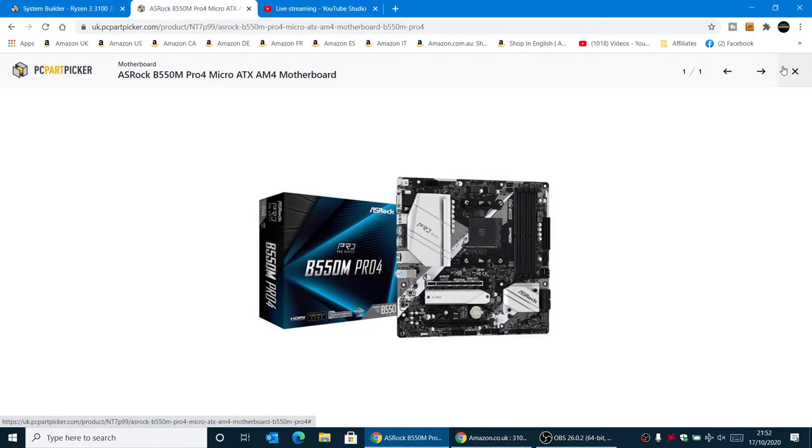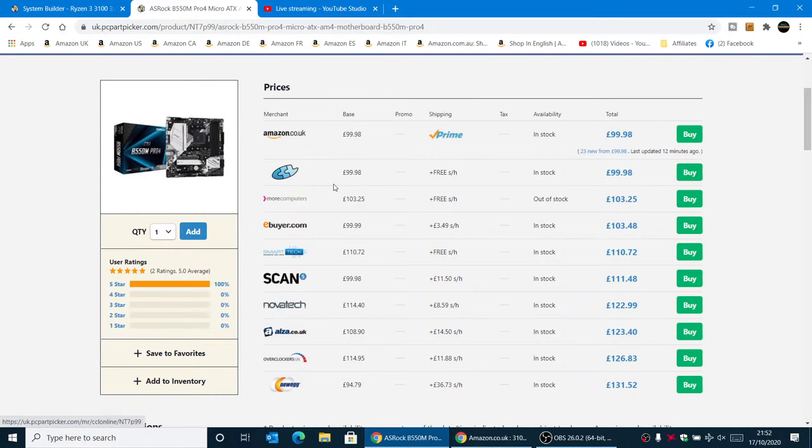Irish Rally said MSI X470 is £85 and will get you BIOS for Gen 3 in January. Yeah, the X470 boards are actually very good. My only issue with X470 and B450 at the moment is that AMD are releasing BIOSes late, i.e. January, and they are going to be beta BIOSes. Let's not forget that. Anything which is beta is basically use at your own risk. So hopefully when it comes to mid-January, February next year, our Discord isn't going to be absolutely littered with people who have got B450, X470 and A320 boards who have installed a beta BIOS to enable Ryzen 5000 series support, only to find they're getting system instability, memory errors, all those kinds of things.